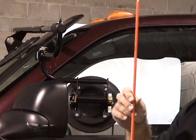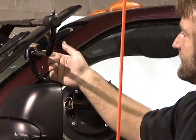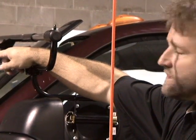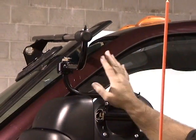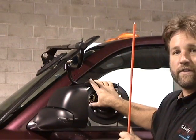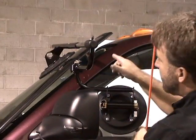Another feature of the tool, Lil-buddy Pro, is this arm that swings. The advantage of having this arm swing is that it gives you another 10-12 inches of reach when you walk around the front corner of the vehicle, and it also gives you a little adjustment so that the base cup isn't that crucial where it's set on the door glass.